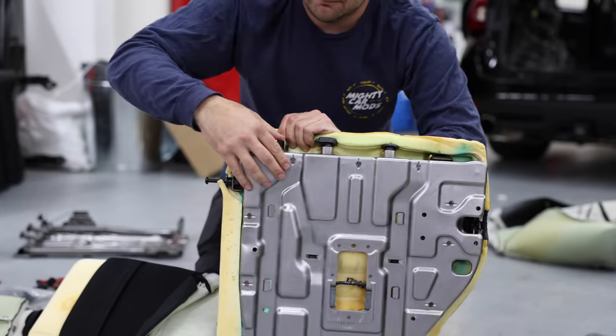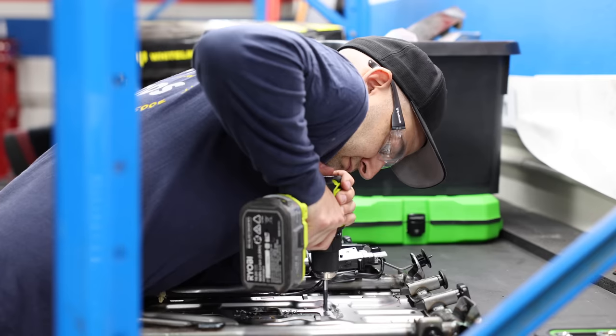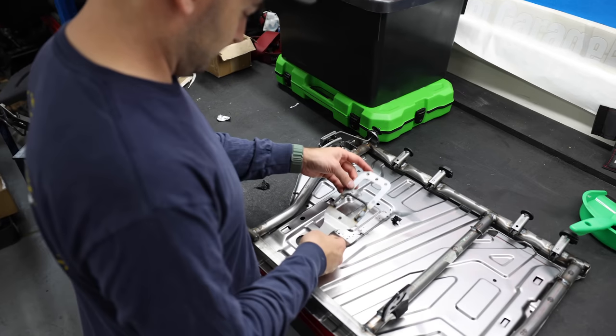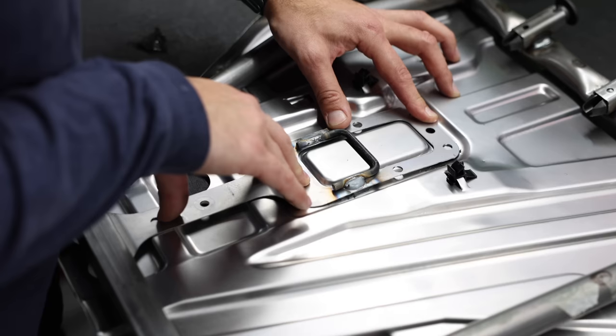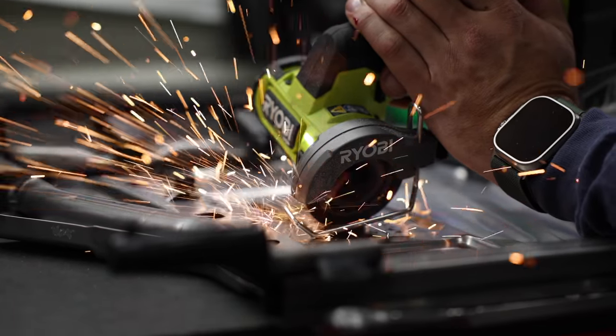The middle and driver's rear side seat, I have to do a little differently. The STI and the Levorg have a different armrest configuration, so the STI cover won't fit the sheet metal backing from the Levorg. Luckily, they are identical except for the anchor point, which I'll simply transfer across from one to the other. Then the foam and cover will fit with only a small amount of trimming, and the entire rear of the car will match perfectly.